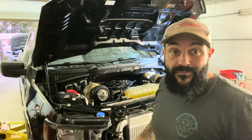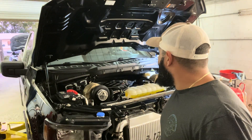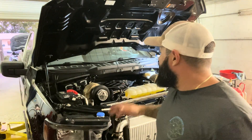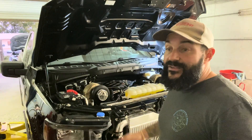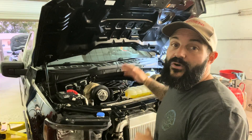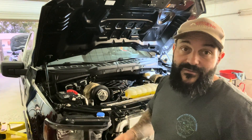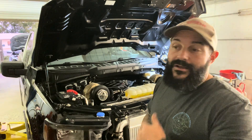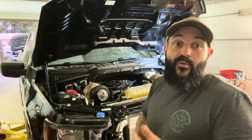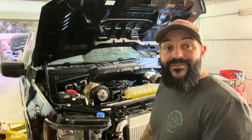It sits right above the manifold. Some guys take off the whole manifold, but you just have to be willing to crawl up there and get that one 8mm bolt off, take off a little harness, and swap it out. The spark plugs are absolutely doable with the downpipes already on. The injectors were a breeze. I'm going to post a link in the description to my friend Big Mike, who provided these FIC 1000s — completely plug and play. I'll go ahead and flash our base map for the injectors and give it the first startup.